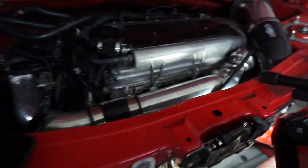I'm also going to replace the serpentine belt today. I have some Monkey Wrench Racing pulleys — I'll show those in a second. I pulled off the serpentine belt — it's a 19 millimeter on the tensioner, push forward towards the front of the car and it releases, then slide it off. The alternator pulley and water pump pulley are Monkey Wrench Racing, and I deleted the air conditioner.